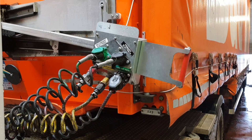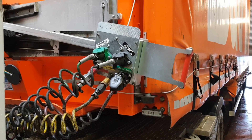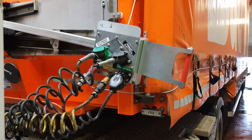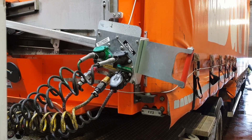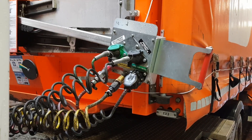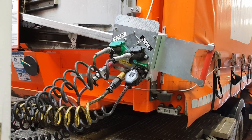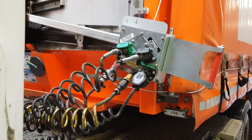This video demonstrates the leg safe system, showing the process with the leg in the incorrect position. The driver comes up to the coupling, and if the leg is in the wrong position, the first thing he'll do is disconnect the lines — more specifically, the airline.